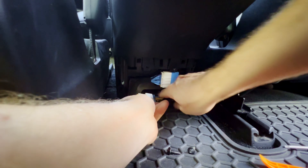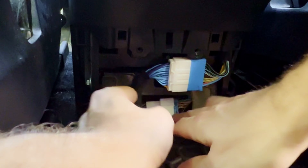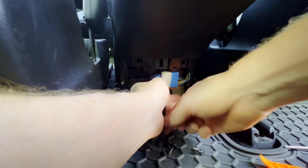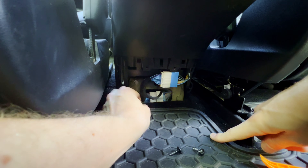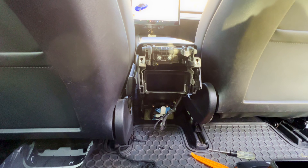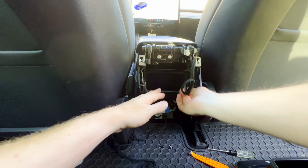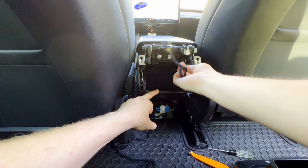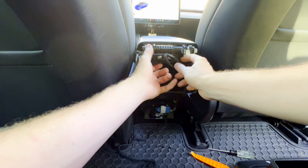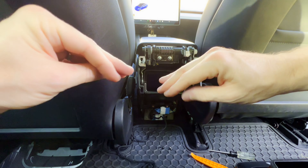You can tuck the cable in here — not too necessary, since there's enough leeway with the cover piece that goes up there. Next, this unit here comes off; it's best to pull from the bottom. You can hear little snap noises. Once it comes off, just grab it here, pull the rest off, and set it aside. The only reason you do that is to route the cables. Take the existing cable and tuck it away — pull it all the way up over the side and push it inside there. You don't need to use the terminating plug; just tuck it in and it will rest just fine.